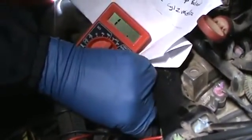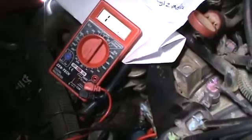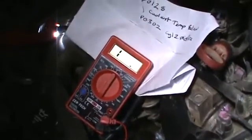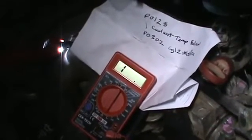I was 110% sure after spending time going across the sensor — he needs a new sensor. Here's what happens: if the sensor doesn't give the proper reading, first it sets the code, then it won't allow the fan to turn on. When the fan doesn't turn on, the engine overheats. When it overheats, the PSI in the coolant goes up, and you blow radiator hoses, blow radiators — hence causing a leak and having to keep adding coolant. So the diagnosis is to replace that sensor, and it shouldn't cost much.